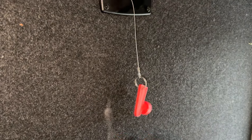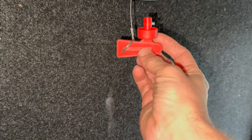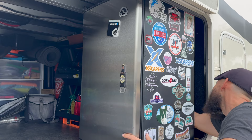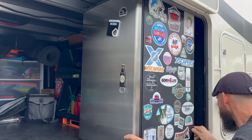The big problem with these switches is that because of their locations, they easily get bumped in our basements and can fall out. What's going to happen is you'll eventually have no power going to anything — the battery won't charge and you won't have any 12-volt systems working, such as slide outs, jacks, lights, and appliances. So that should always be the first thing you go to check.